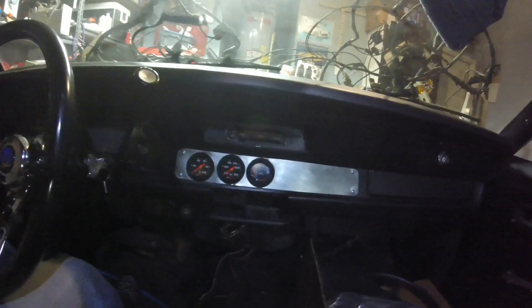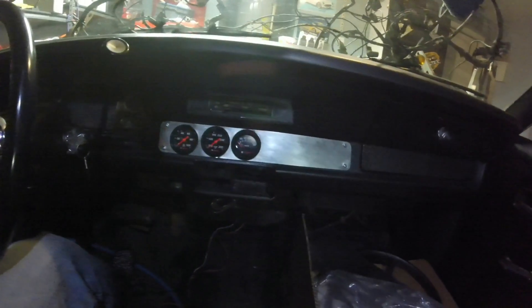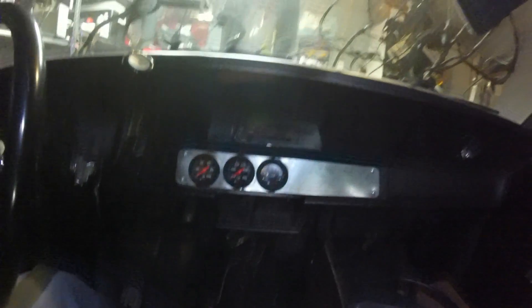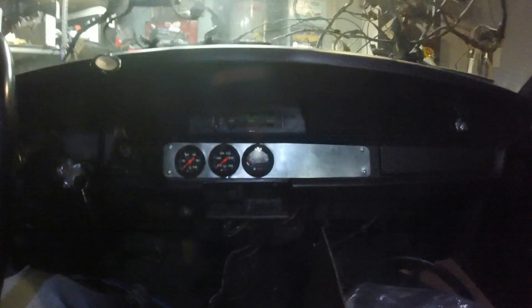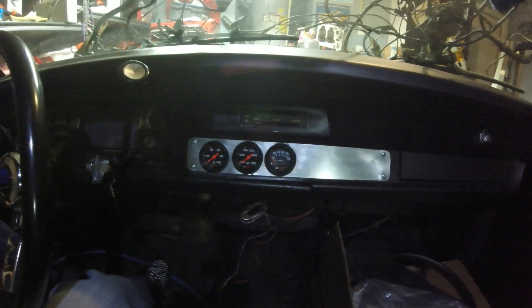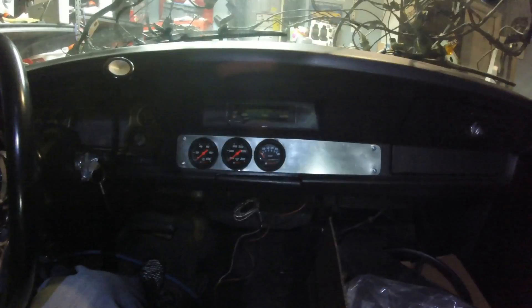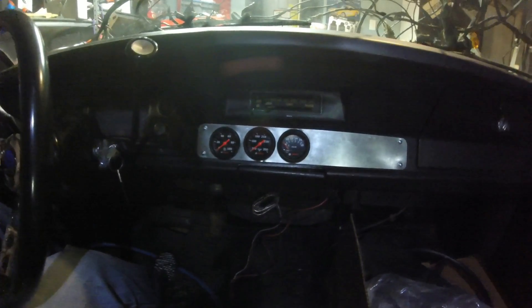There you go — it's not perfect, but this car is not supposed to be perfect. It's just a thrown-together fun street and strip car. I got all three of them in and there's space for almost three more, though they're not perfectly spaced out — no big deal. I think they actually look pretty good; the black really matches the dash itself. I don't care for gauges that hang below the dash — they look bulky. Since the dash already had a big hole where the radio was and I'm not running a radio anyway, I put the gauges there. That's pretty much how I put three gauges in. They're not wired up yet because there's no motor in the car. Hope you guys have a wonderful day — see you next time.